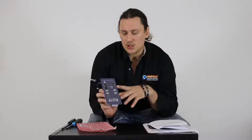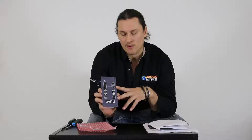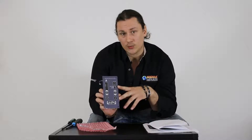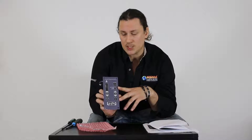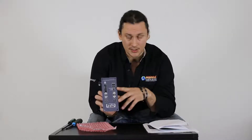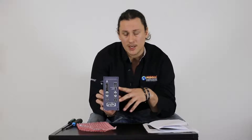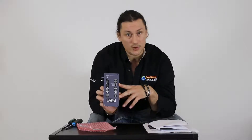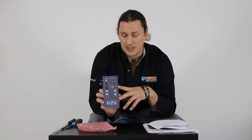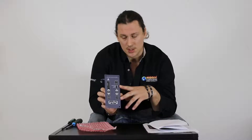This is the new style St. Croix control board that replaces all previous digital control boards on St. Croix. If you have an early model St. Croix that has a rotary turn knob and rocker switches, there will be a retrofit control board kit based on your model and your serial number. For all units that currently have a digital LED board, this is the newest style board for both the corn units as well as the pellet units, and we have a program cycle that needs to be set once we have this installed.